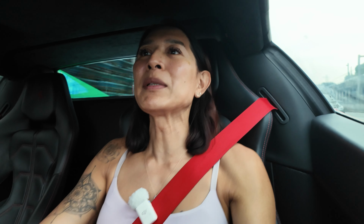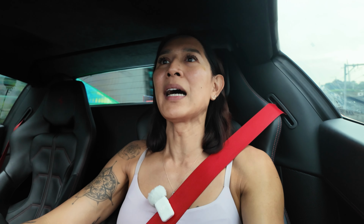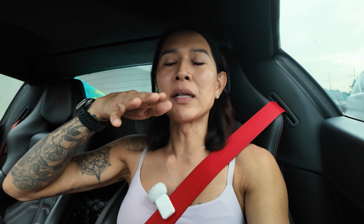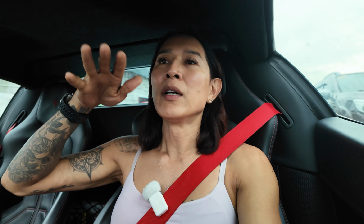A lot of the World Time Attack cars actually have laser sensors built into the chassis so that they can measure the ride height during full compression, especially when the cars are cornering at high G loads, because what happens is obviously one side dips and it loses the ground effect, so to speak, because it's too close to the ground, and the other side lifts off as you're turning. A lot of the World Time Attack cars have sort of like a double suspension, so one for regular compression rebound, and when full downforce takes effect, the second one actually sort of pushes up on the first one to make sure that they don't bottom out.